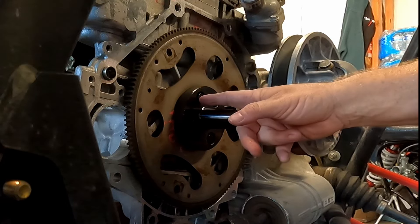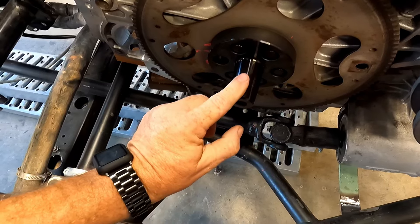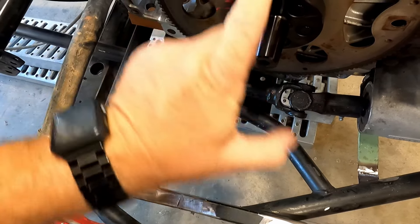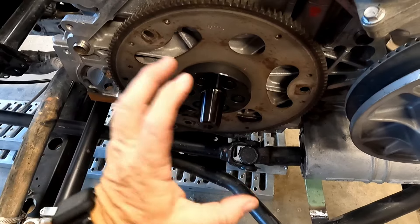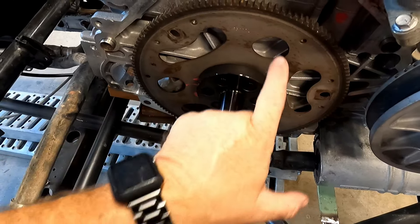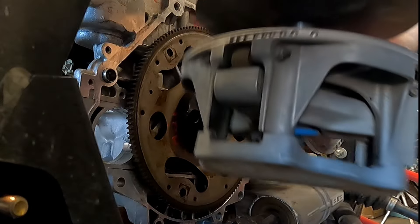The head is a 12-millimeter socket and as you can see it worked perfectly. Here is the adapter — this is a 33-millimeter adapter at this point, but you can also use a 30-millimeter clutch on here. Using the 30-millimeter clutch would push the engine further out to align the clutches, but that's not what I want. This engine is going to put out a lot of power and I need to think ahead, so I want the larger clutch. But we can put the 900 clutch on here just to show what we've got going on.